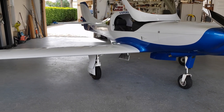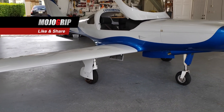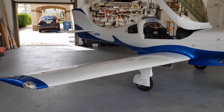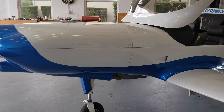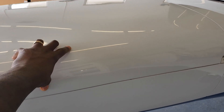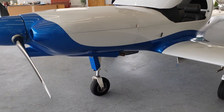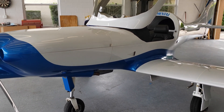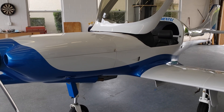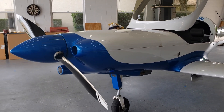The Lancers are speed machines. We've reviewed the 320, and if this looks similar to the 320, that's because it is — except this is the newer version of the 320. If you look at the nose here, the power plant is the Lycoming IO-360, but this one has an IO-375. It's a 360, but powered up to 375, so you've got about 210 horsepower in this airplane. It's still using a two-blade prop.